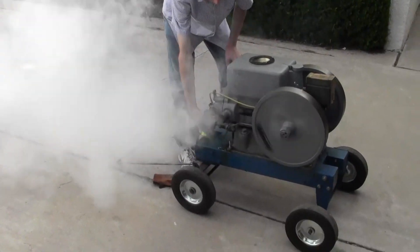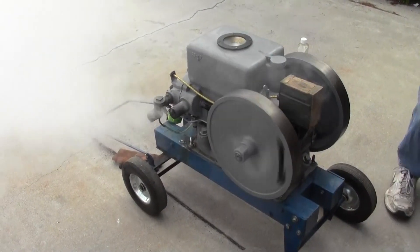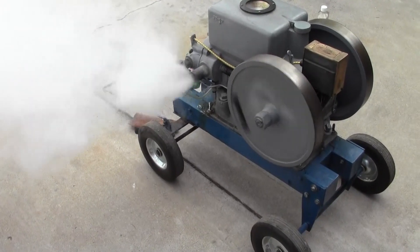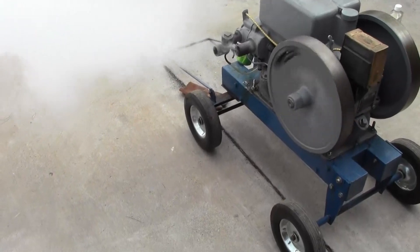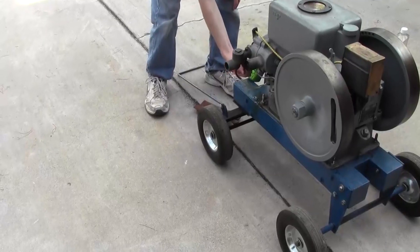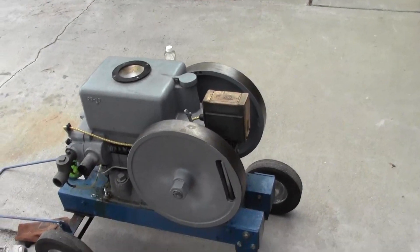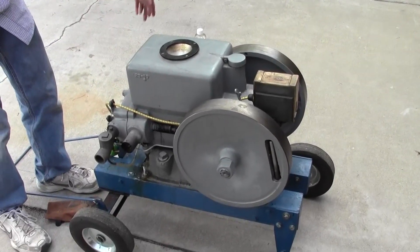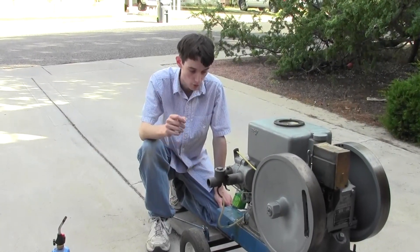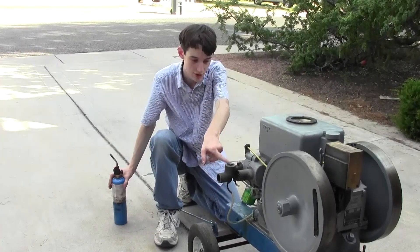It soaks in kerosene down here. That is just so pretty — I just can't help myself. You've got to be careful though, this smoke is going to be incredibly flammable. One and a quarter turn of the needle valve here. On gasoline that'll run on just over a quarter of a turn — I probably could have gotten it to run a fair bit more rich, but this stuff is expensive and it just sucked it all up. With all this smoke coming out the exhaust, that would be perfect to burn. So very carefully, we're going to bring this up richer and richer, have a flame out here, and see if we can get this to sustain a flame on the exhaust.